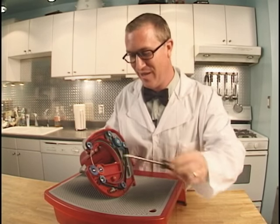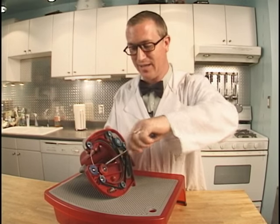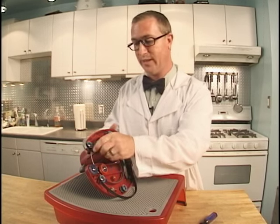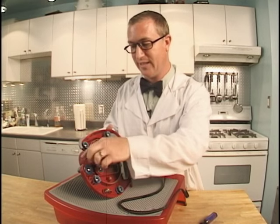Alright, I'll do it. First, loosen the inside grommet and slide it back. Then release the belt from the spring tensioner arm. Unravel the belt from all of the pulleys. When you get to this point, pull the belt out and the blade is released. It's that easy.